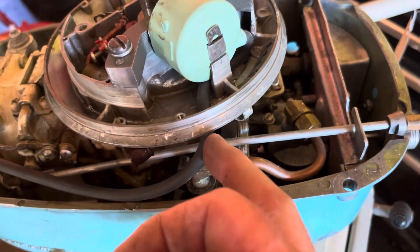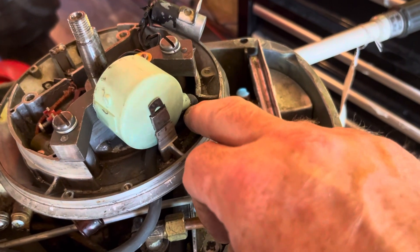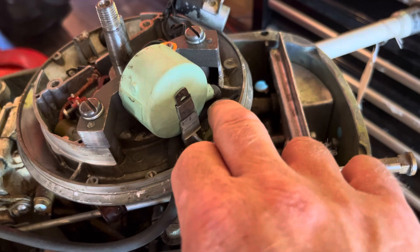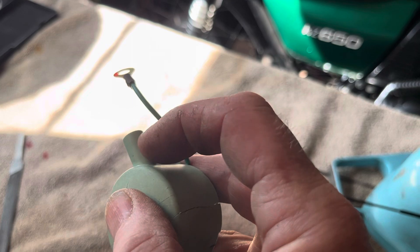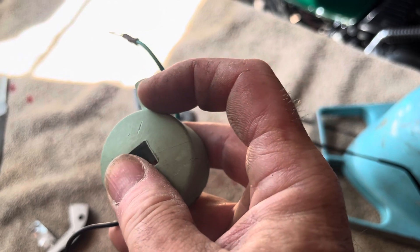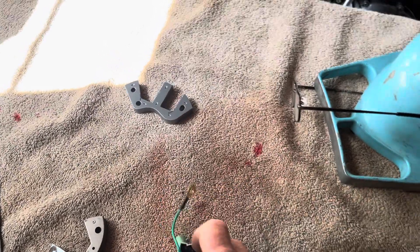Another thing: on the Mercury the spark plug wire would go on this side, but on these cheap coils it goes on the other side. So you have to route the wire through the original hole, snake it around, and do a pretty aggressive bend. What I did was take off a good chunk of the sleeving — you don't really need it and it just helps with the bend radius — and I ground that down a bit. Then you get it on there all the way and it's just a perfect little fit.